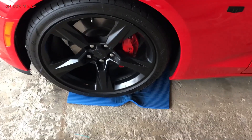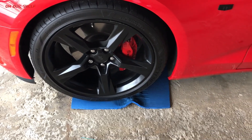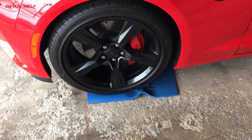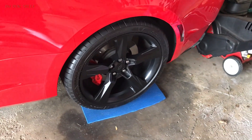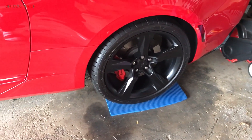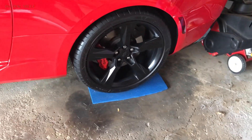The other thing I do is over-inflate the tires by about 10 PSI from what I normally drive at. This is just to avoid flat spots, and I also park them on these little mats right here. This isn't necessarily necessary — you could just drive the car after a few months, a couple of miles, and usually the flat spots will work themselves out — but this is just what I do.